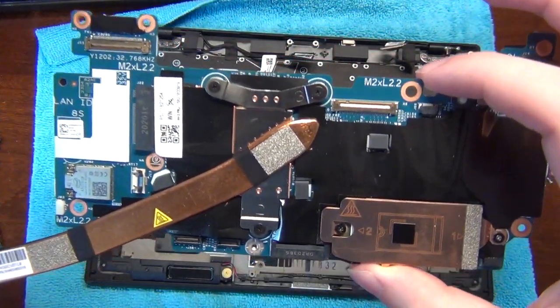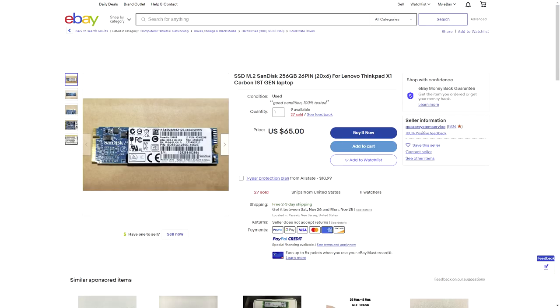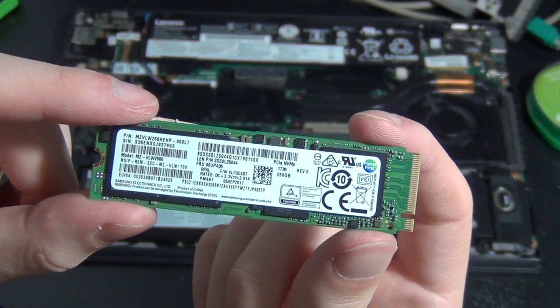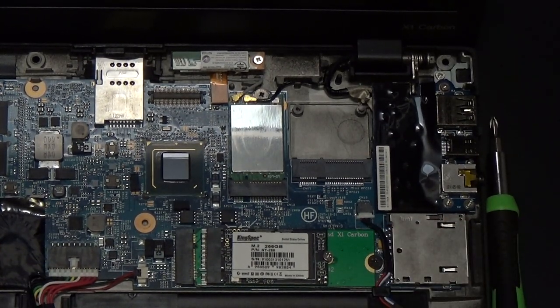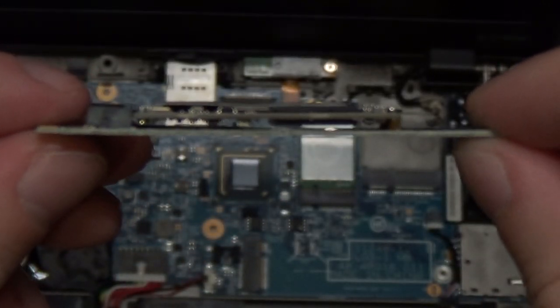While the SSD is technically a replaceable component, it is not easy due to Lenovo's choice to use a non-standard 20+6 pin form factor. The original SSDs for these machines are hard to find and expensive, so the best way to upgrade or replace the storage is to use a cheap adapter that allows you to use more standard SATA-based M.2 drives. The original X1 Carbon does not support NVMe SSDs. Lenovo realized that using a non-standard format was a mistake and has used standard M.2 drives for subsequent models, but it's a royal pain to deal with on the 2012 X1 Carbon, and in my opinion is one of the biggest drawbacks of this laptop. Additionally, if using an adapter and an aftermarket SSD, you have to be careful about its physical size — if the drive takes up too much space, it can push up on the palm rest and keyboard.